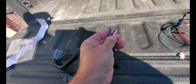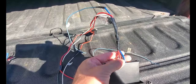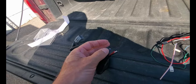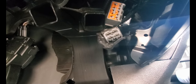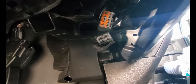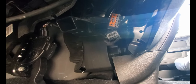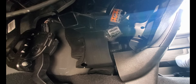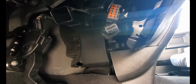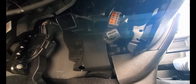This is the connector I need to plug into under the dash of the truck, under the heater controls. It should be a standard hookup: black for power, white for ground, red for signal, blue to the trailer brakes — an exact match to this harness. There are two connectors here: the square one on the bottom is the one I need. If this truck had the factory brake controller, it would use both connectors. You can buy that from the dealer or aftermarket — it's a module plus the dash piece — but that costs about 200 bucks and requires a dealer computer flash.